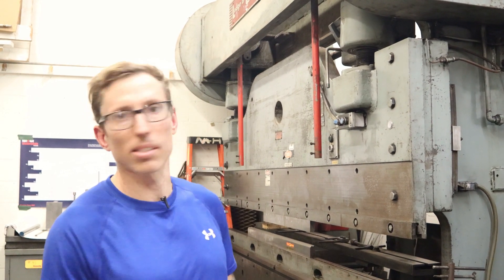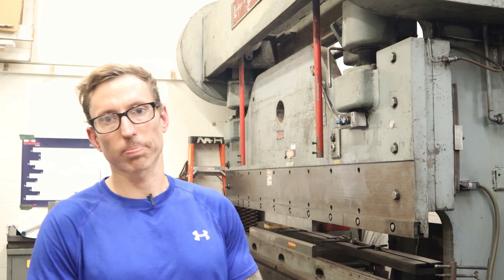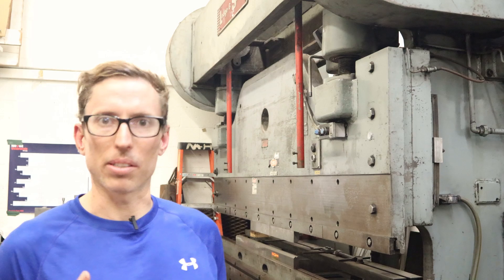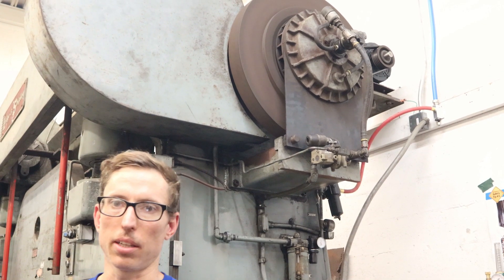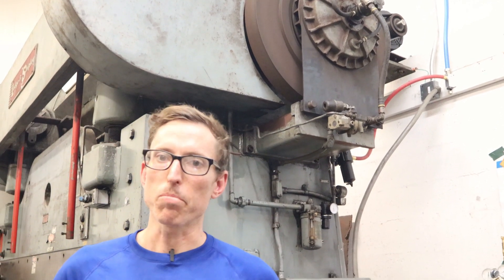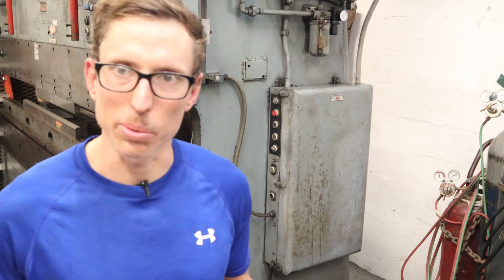Super happy with the outcome of this whole brake press flywheel rebuild. Right now, in the past you would have to have hearing protection just to have this thing operating. The amperage draw once it's up and running is about six amps. So if you have any more questions on how we did this, or maybe there is something we left out and it might pertain to you — if you needed to do a similar project replacing some bearings in a heavier piece of equipment — feel free to leave a comment. Otherwise I hope you enjoyed. Please like and subscribe. I guess that's what you're supposed to say on the YouTubes. Thank you for watching.